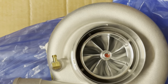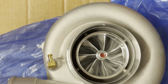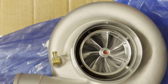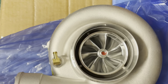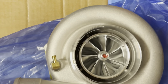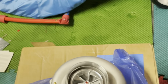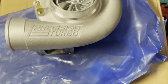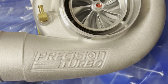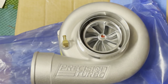Generally speaking, because of the back pressure on the K24, and I'm using a sidewinder manifold by TSM Race — I'll drop a link in the description for that manifold — it's also going to be a T4 with a Turbo Smart 60mm wastegate port. The sidewinder manifolds are known in K-series world for assisting larger turbos in their spooling characteristics because of the design and shape. In addition, the way the K-series build creates a lot of back pressure because of the engine being so compact.